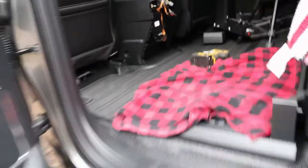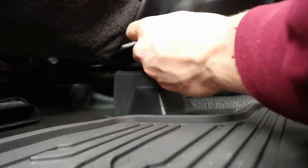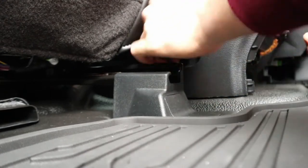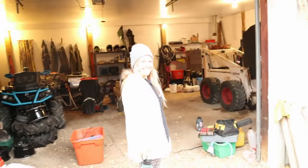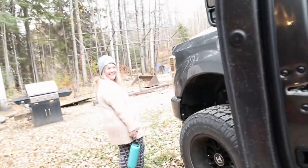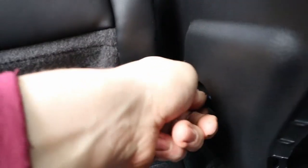Now you'll want to take your seat, move it all the way ahead. It comes through the back door and there's one more. Now walk around to the other side and I'll show you what to do with that one. Same as the last one — seat all the way back. Work around this one. It doesn't have the bolt at the front, so get your fingers in there and get it to pop out. Just like that. And then we have a bolt right here, one behind.